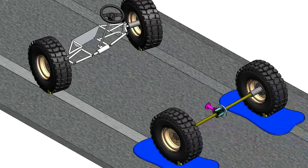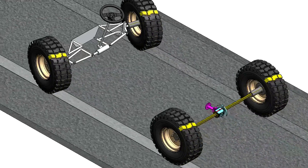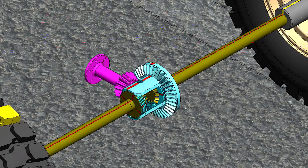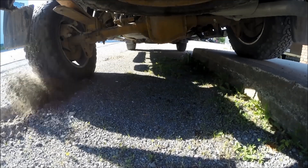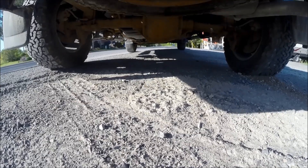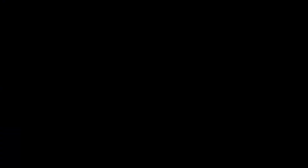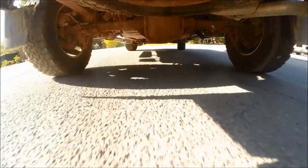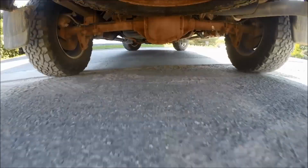Therefore, both wheels spin at the same RPM. This does overcome the previous traction difference problem, but it does not limit wheel slip any differently than a locked rear axle. Over time, LSD shim packs will wear out and slowly revert back to an open differential. Off-road, an LSD can still slip the clutch pack resulting in one wheel drive. If one wheel is unloaded or off the ground, the torque to the loaded wheel can become higher than the torque required to move the vehicle forward, and the clutch packs will slip. Torque to the loaded tire is now limited by the holding power of the clutch packs. During a constant speed turn, the inside wheel attempts to drive at the same RPM as the outside wheel. On pavement, the clutch packs slip to allow the tires to match surface speeds. An LSD is always generating heat and creating power loss while turning on paved roads.